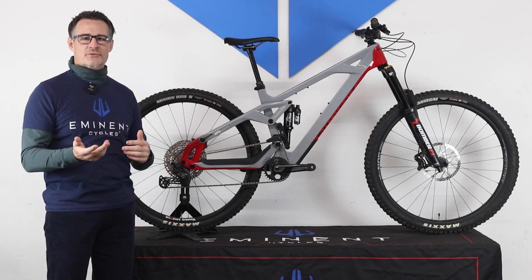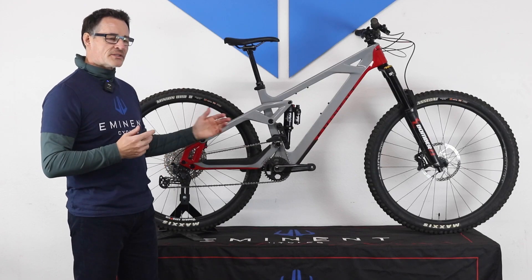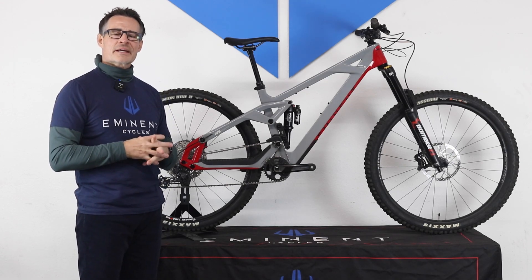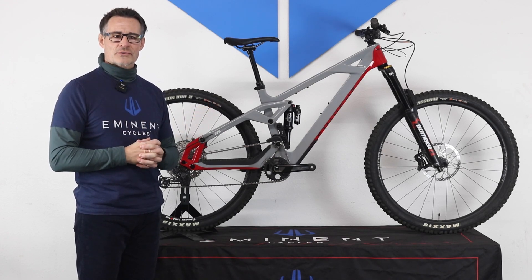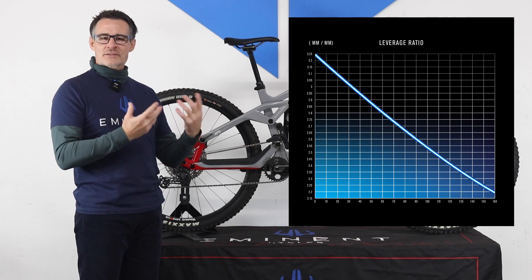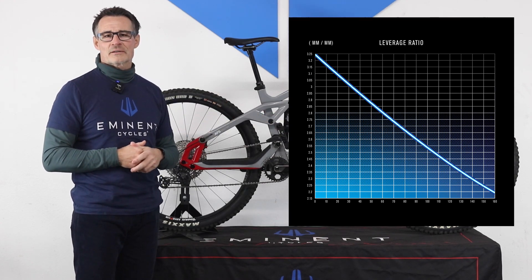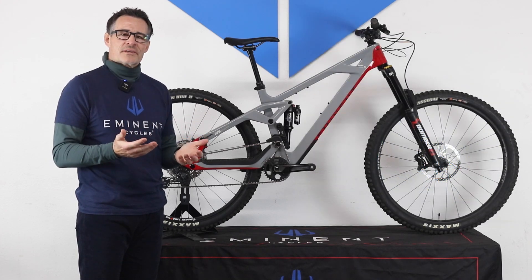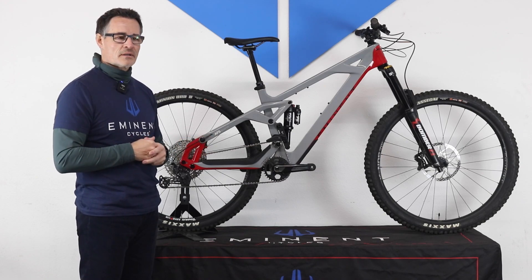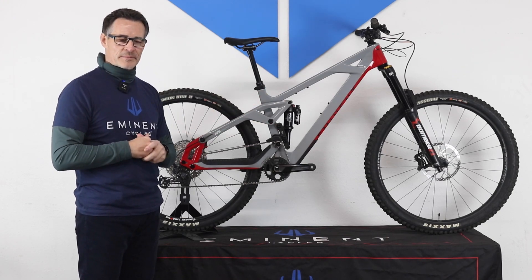The second part of the equation: leverage ratio. What we did with this bike is we added a new type of shock link, different than our Onset. With that shock link, we were able to change the shape of the leverage ratio curve and its progressivity. The leverage ratio curve is a line on a graph that shows the travel relationship between the rear axle and the shock plotted on a curve. Our line shape in this case is a straight line going down at about a 45-degree angle, which equates to almost equivalent to a spring compression curve — as natural as we're all used to from coil springs on bikes, cars, or motorcycles. We wanted to straighten that out so the suspension stands up a little bit more in successive corners and resists bottom-out a little bit better.